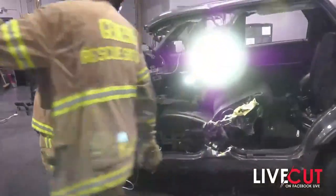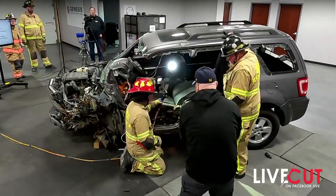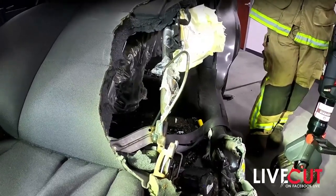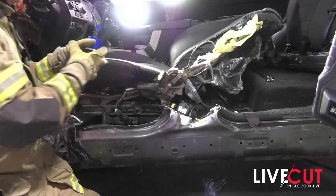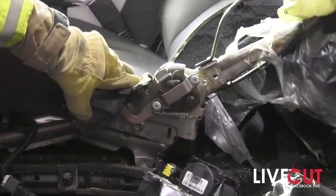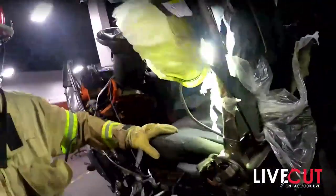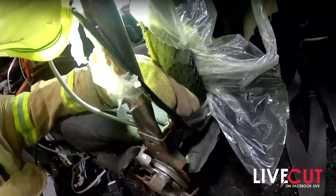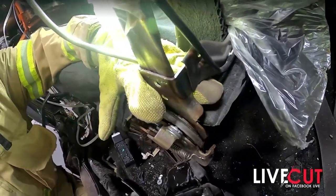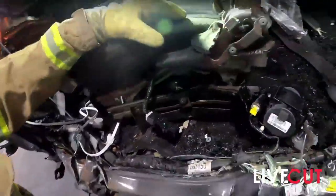Let's come over and take a look at our seat back. We've already removed the seat back material for you — in the real world you'd do a little bit of this to determine what type of material is down here. These hinges are usually a harder type of steel — not necessarily ultra-hardened strength, but a harder type of material. You want to try to determine how it looks on the inside and potentially from the backside. You'll see we have an extra support bracket here. Cutting blindly through here, sometimes one cutter will go underneath on one side and come up on the opposite side, meaning the seat will not be completely cut out.